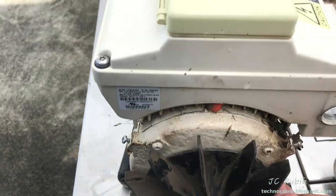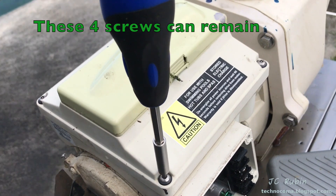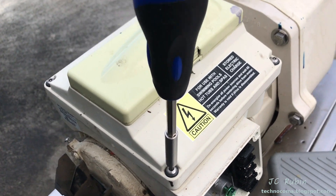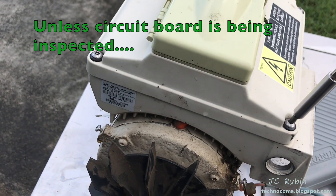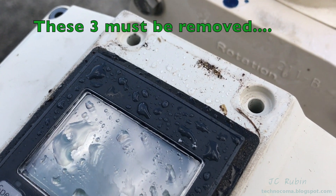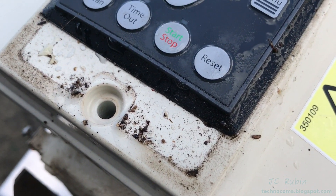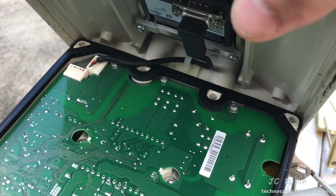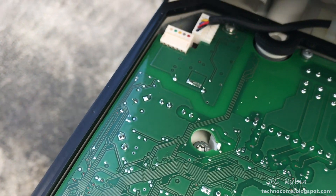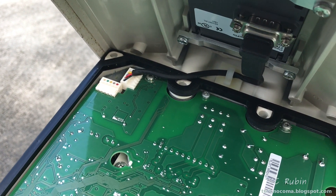Which is better than replacing the entire unit. But I want to see what's going on here. I'm going to start by taking off the control unit — I don't want to damage it, just get it out of the way. I have to remove this before I can get down to the screws that connect it to the motor itself. This also includes the three screws under the cover, so these have to come out — they're long screws. The whole cover lifts up. I check for any breach; I don't see any. Everything's nice and dry, nothing happened in here.